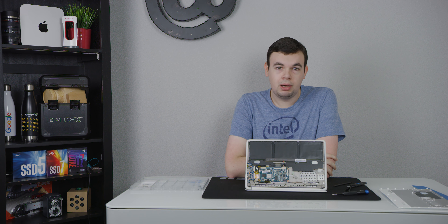So it seems like it may not just be that the battery isn't charged — it's completely dead, not even being found. This is going to need a complete battery swap. Unfortunately this computer is not going to be fixable the way I thought. I saw someone else having the same issue — they unplugged the battery, plugged in the power cable, then plugged in the battery and it worked, but unfortunately that didn't work for me. It does power on, but it doesn't run off of battery power — it runs off of wall power. The battery is no longer detected, so this is probably going to need a complete new battery.